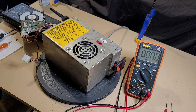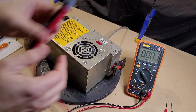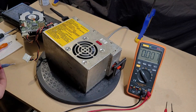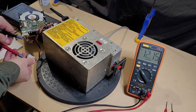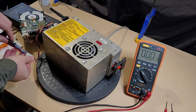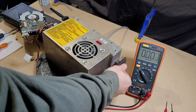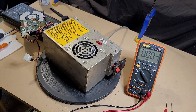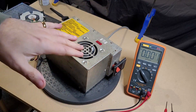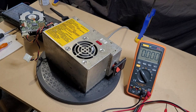Cool, so let's get it all put back together and then we can move on to the next step. We're all back together — let's just give it a quick spin and make sure nothing changed. Everything comes on, hard drive is spinning. 12 volts — 5 volts — okay. I'm going to call that good for now. Hopefully that 12-volt rail that was a little bit low on the connector is fine. We'll keep an eye on that and see if it gives us any trouble, but yeah, for now I'm going to call that good. That's super encouraging — if the power supply was not good, that would be bad. Alright, so I'm going to put this back in the case and we'll get on to the next part.